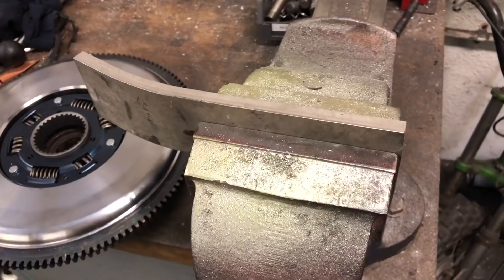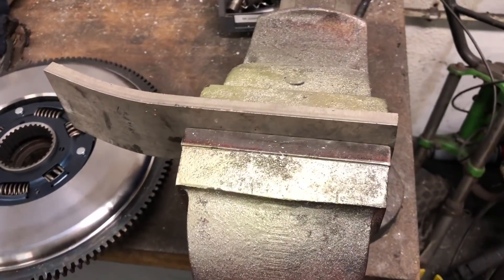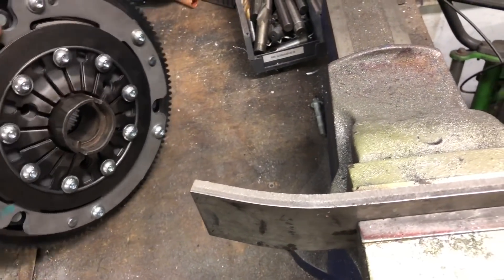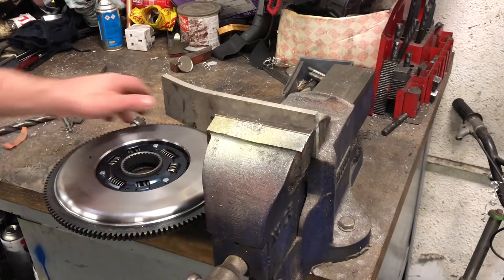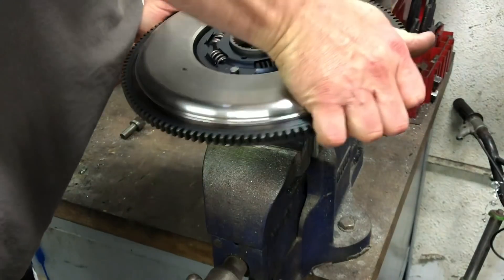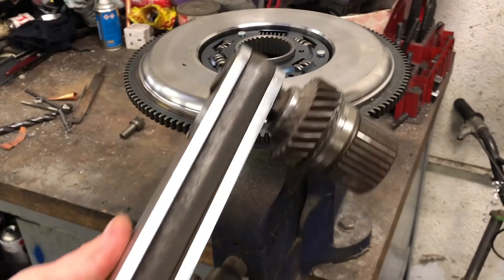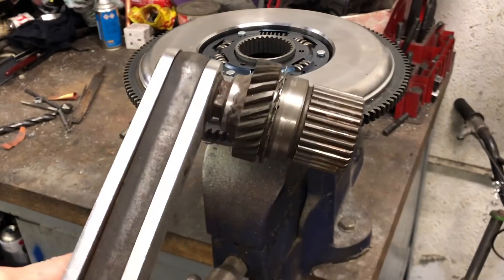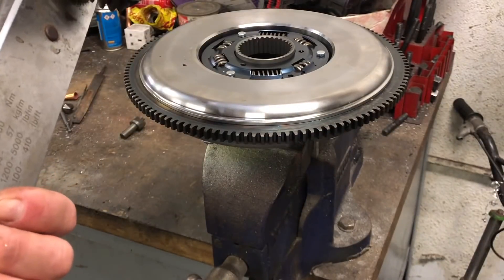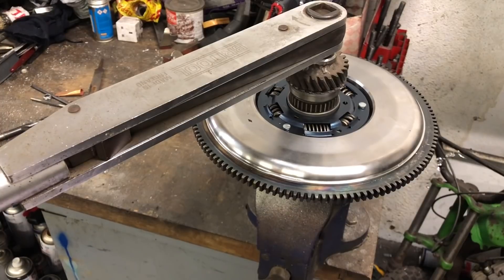For testing, I've put an 8mm piece of steel plate in a vice, standing up about 20mm, to hold the flywheel via the key slot on the other side. Just going to drop the flywheel slot onto that piece of bar. The next tool I use is a three-quarter inch drive torque wrench. I've got a primary gear with a three-quarter drive socket welded into it — we're going to check the torque on the clutch. The torque wrench is set to 180 foot-pounds.